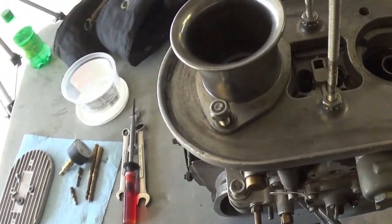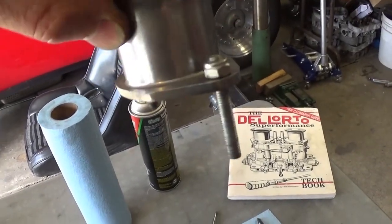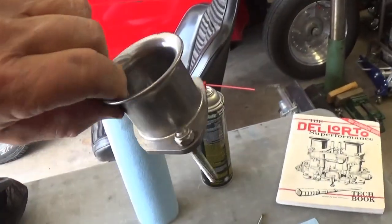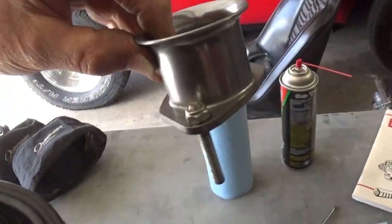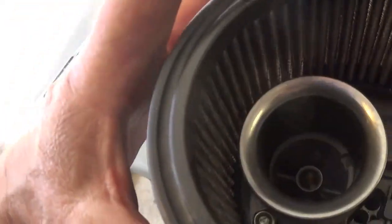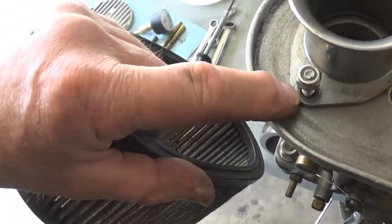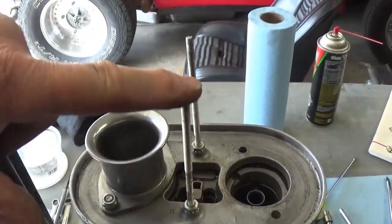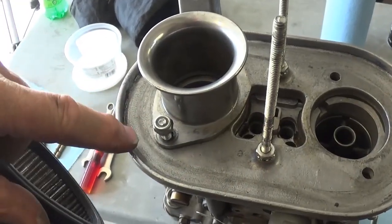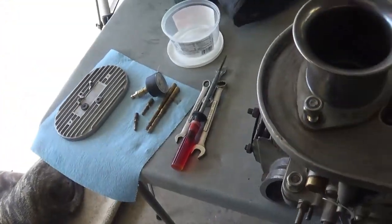Okay. What happens is these beautiful looking things, you see how they're so crazy looking? There's no real consistency in that shape there. I'm talking right around this flange. That's because the flange protrudes beyond that edge of the filter. And so you keep tightening on the top of the filter, trying to get this filter to mash down and look flat, and then you start deforming your filter, getting these wrinkles in it and stuff like that.